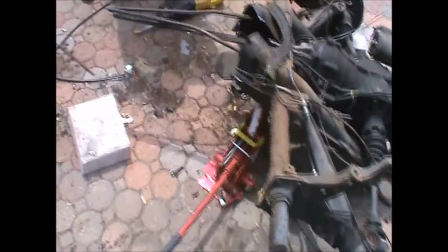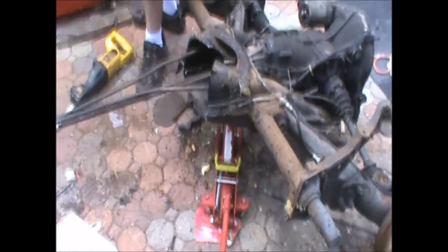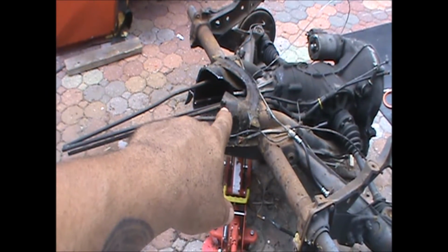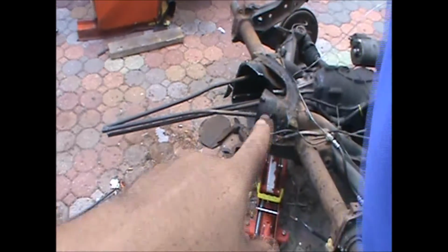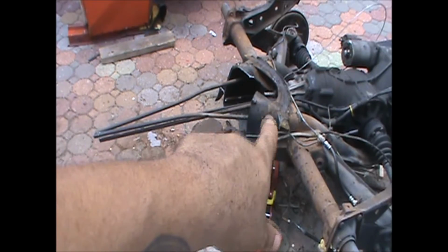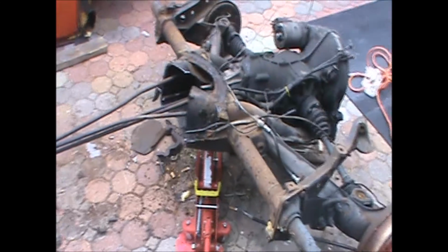When we get it back to the shop, which if anybody's kept up with my channel, you'll notice by the shop logo, Chop Shop Customs, that's when I'll do the final cleanup on this, getting rid of this excessive metal. We'll clean all this up, get it closer to the torsion, clean up the frame horns on this back side, and this will be ready to weld in.